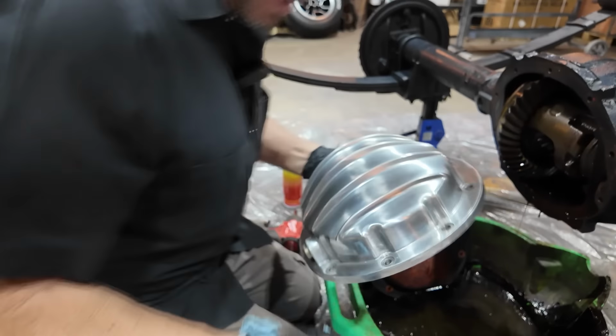So I've got the front and rear assemblies more or less aligned with where they're going to go on the actual body. Now is the time in the dance party where we lower the body off of the rotisserie, get it onto jack stands, and then weasel the front and rear systems up into place. I've got to tell you, it's not my favorite thing because it's just kind of unbalanced. It's rear heavy, it's risky, it's higher than the jack stands go, and it just makes me a little nervous. So I'm going to be super slow and methodical and just take my time, and hopefully we don't drop the body onto the concrete floor because that would erase a lot of work.